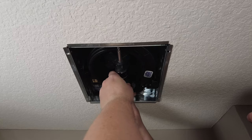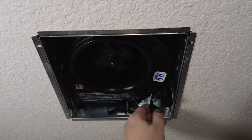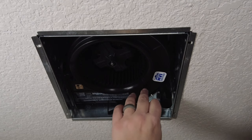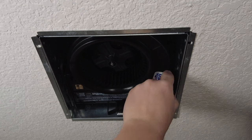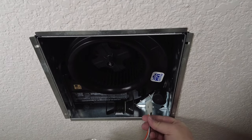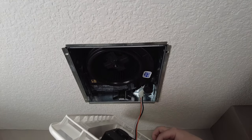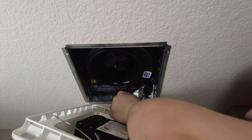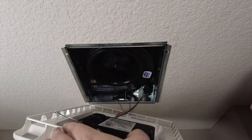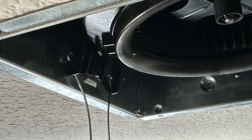This popped into place on both sides, so the fan is in. Now we can install the screws. We're going to take this plug, unhook it from the fan, and plug it into the electrical connection. Next, we're going to plug in our light — make sure it's plugged in all the way. Then we're going to take our springs and hook them in here, doing the same for both sides. These don't hook into a metal bracket — they use the plastic that's part of the blower motor.